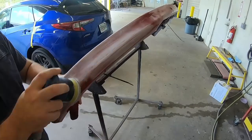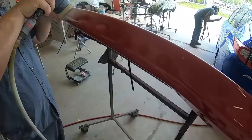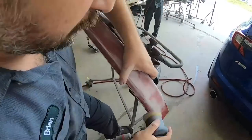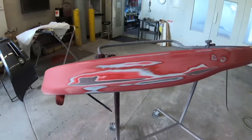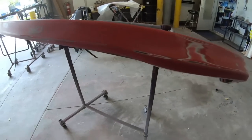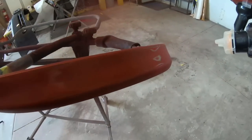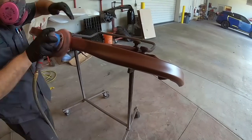With our bumper covers all completely done, it's the same prepping process for our final accessories. We have our front lip here, which you'll see we'll sand down. We're using a P180 grit as well, and that will get primer. Then we'll move on to our grill as well as our rear spoiler. So enjoy the beats as we move through getting all these pieces painted.